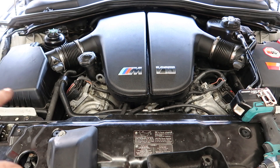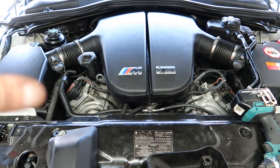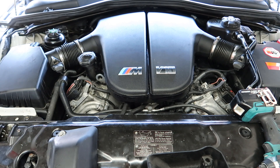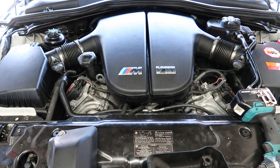The engine is running — I'm just waiting for it to start misfiring. It takes a long time; it needs to get up to temperature and run fully on the sensors before it starts missing. It runs fine on a cold start, and then once it gets hot — after idling five to ten minutes — it will start misfiring. I've already got the scanner plugged in, I've cleared the cylinder five misfire code, and I'll re-scan when it misfires to see if the misfire moves to cylinder 10. It was on cylinder five on that side, but this one was also throwing a light for cylinder eight, which is actually the coils the previous owner replaced.